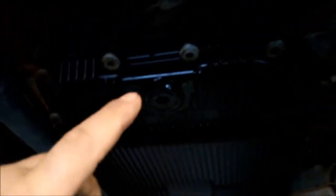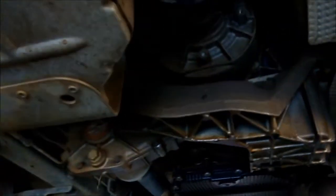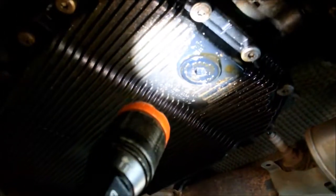We can see the pan's leaking — it looks like it's on that plug. I'm just going to have a look for any other leaks. You can see the majority of it's leaking on that plug there. It's also a little bit damp around that mechatronic plug up there as well. So it's just the old usual problem — leaking at the pan and at the mechatronic plug.